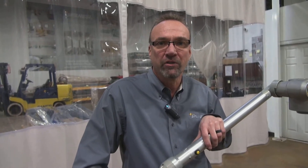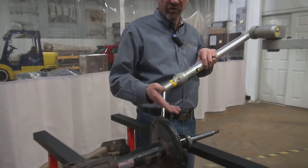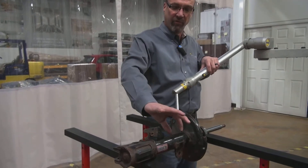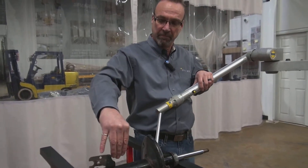Easy Touch users, don't forget about using the straight line angle in your mechanical items to be able to check suspension parts. If we take a look at this strut here, by using a straight line angle I can take three measurements around this strut all the way down the length four times and then be able to calculate if there's any misalignment.